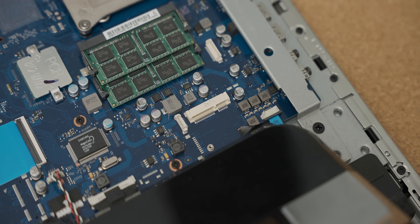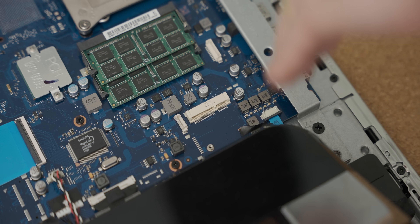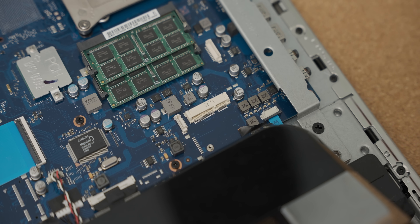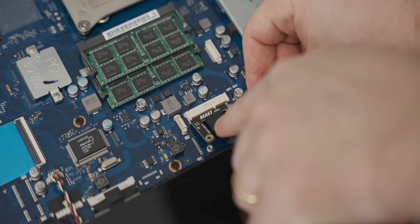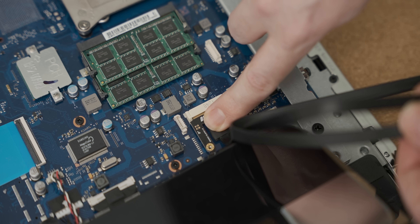The first concern is clearance, because as you can see here, this mini PCIe port is very low in the motherboard, and then there's this huge plastic hump here which is in the way. But because it's a ribbon cable, I'm hoping that we should be okay. So slide that in there, push it down, and yes, it does actually clear. So we're good.